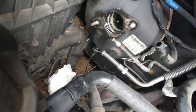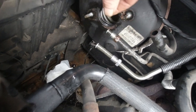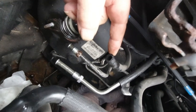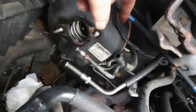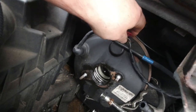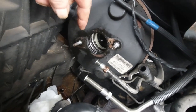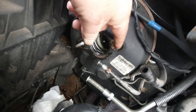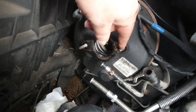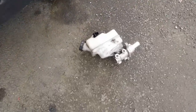It was just a matter of taking the two brake pipes - front and rear lines off - taking the clutch off, which is just a rubber pipe, they're gravity fed anyway, and the fluid level low sensor, and taking the two bolts off. That was as easy as that, and it came off.